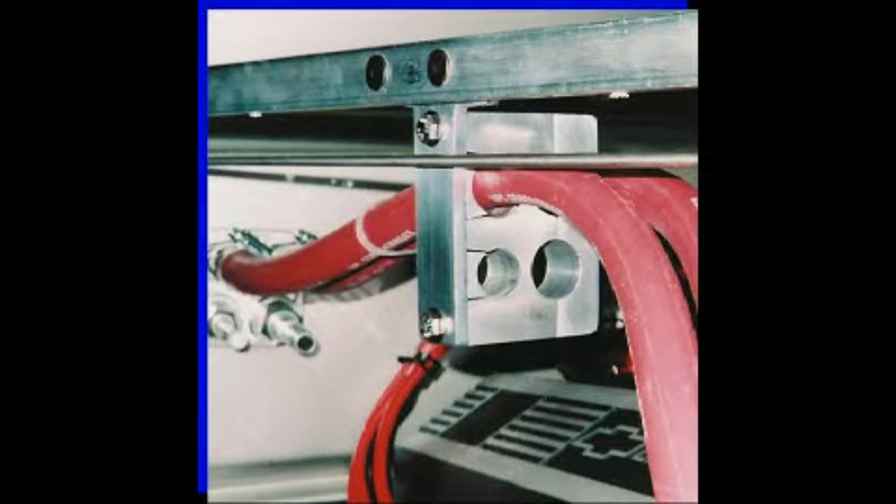With two air conditioning hoses and two large water lines located in this small engine compartment, this homemade bracket routes them neatly on the upper hood support. It was made from one-inch-thick aluminum and polished. It comes apart in sections to capture the various diameter hoses. The four hoses enter the interior using a vintage air bulkhead fitting, which keeps the firewall very clean. Even the air conditioning dryer was installed under the dash.